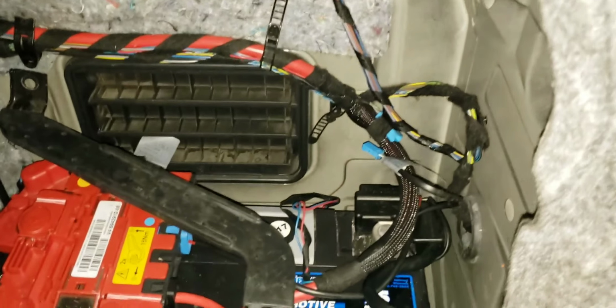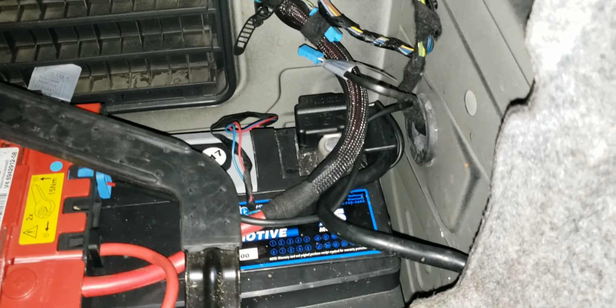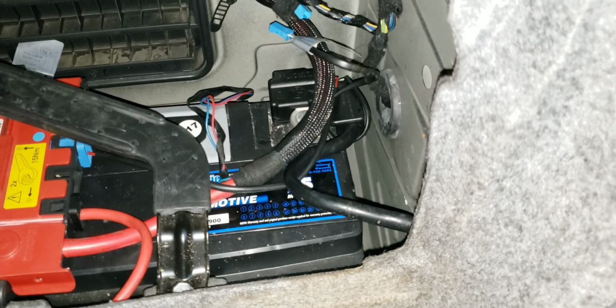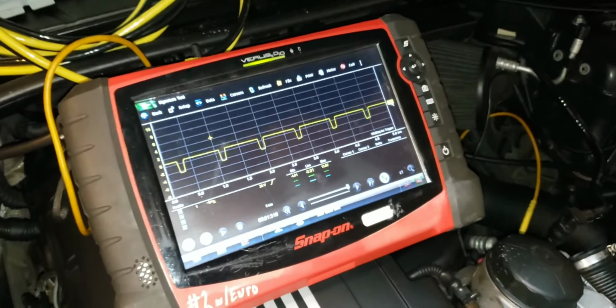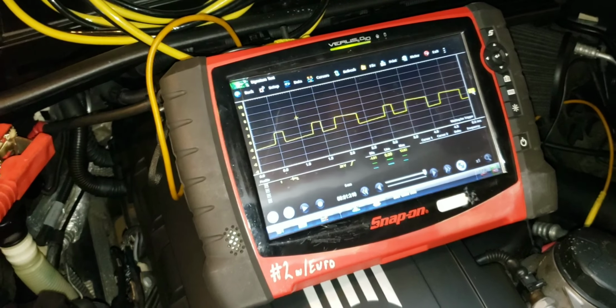For now, we can either leave it unplugged. I believe it actually can be coded out as well. I'll give him the option. Best to get it back to factory original condition. New IBS sensor. Thankfully, did not cause internal damage to the DME. I have seen that. It takes down the BSD circuit inside the DME. This time around, IBS sensor faulty.